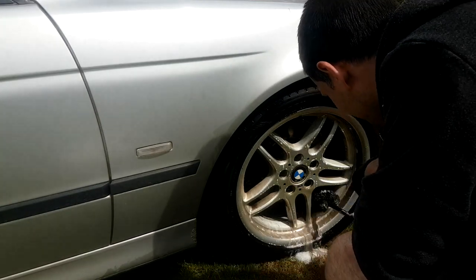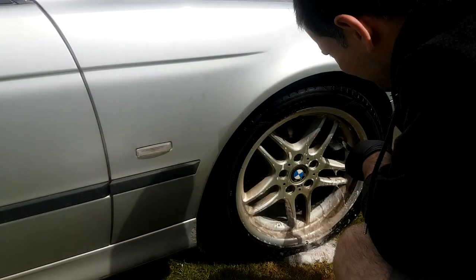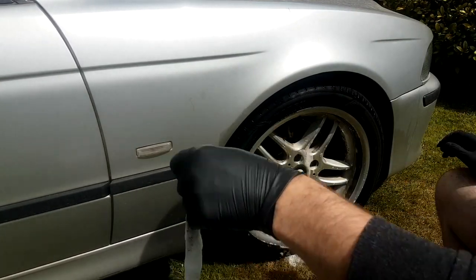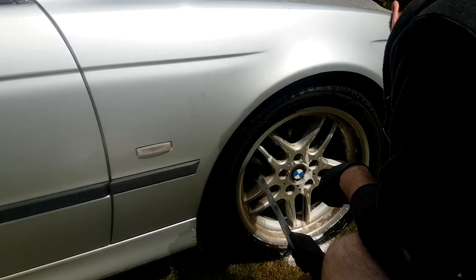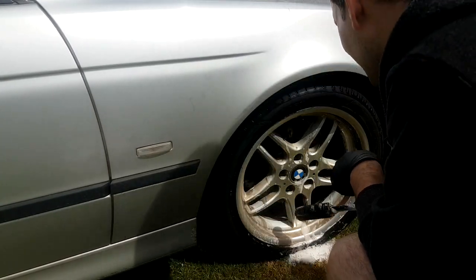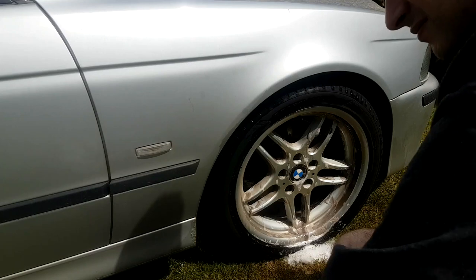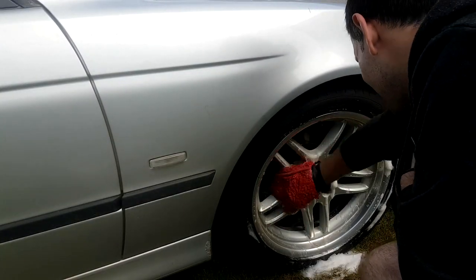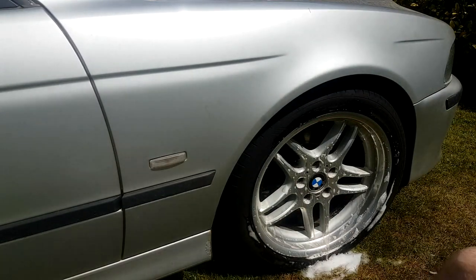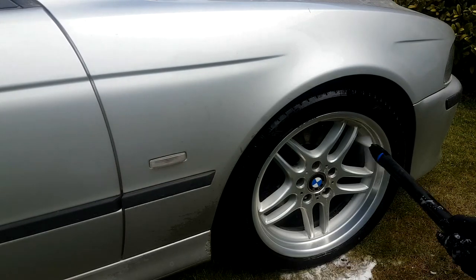There will be a softening pre-wash type effect from the All Clean on the wheels, so just giving them a thorough rinse at this stage and then going back in with more of the chemical - it costs you very little extra time but it is worth it. Now I'm going to start from the wheel barrel and work from the back of the wheel to the front. For me that's always the large wheel woolly for the biggest areas. I'll then move down to the medium size which fits nicely between the caliper and the wheel, and once I've done that I'm going to move on to the wheel face with a selection of brushes and the wash mitt. Being sure with the wash mitt to give the spokes a bit of a reach around just to make sure I get the dirt from the back.